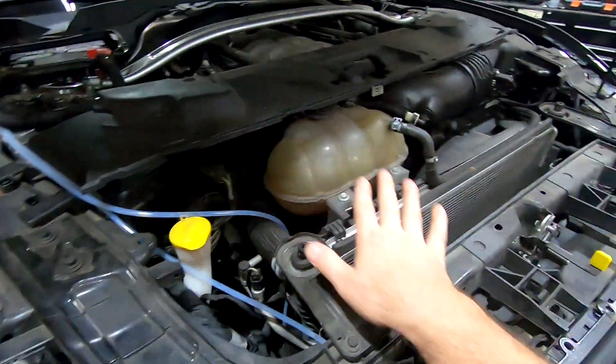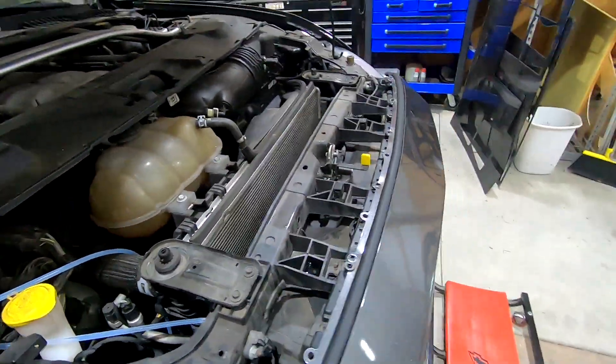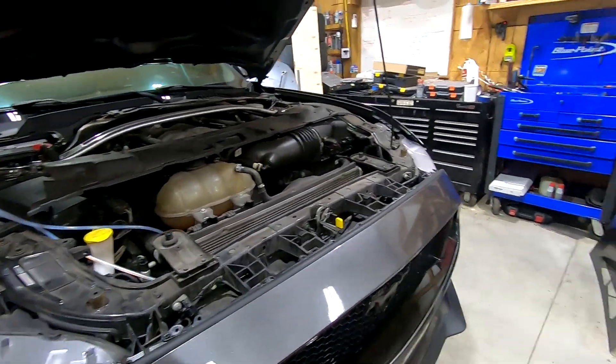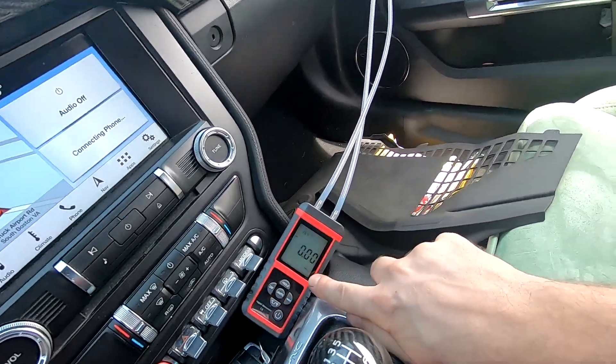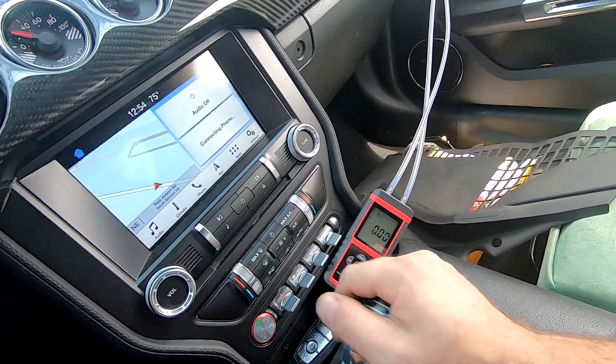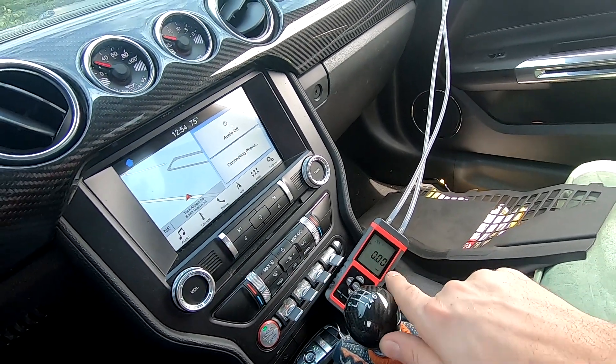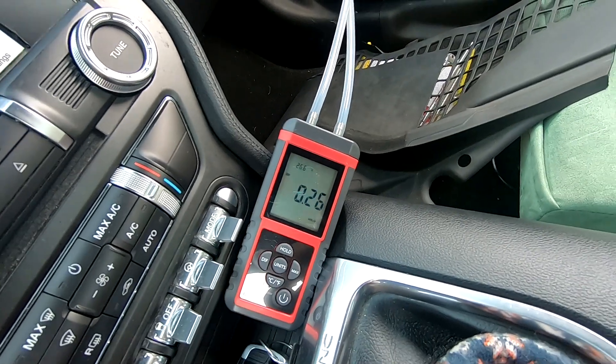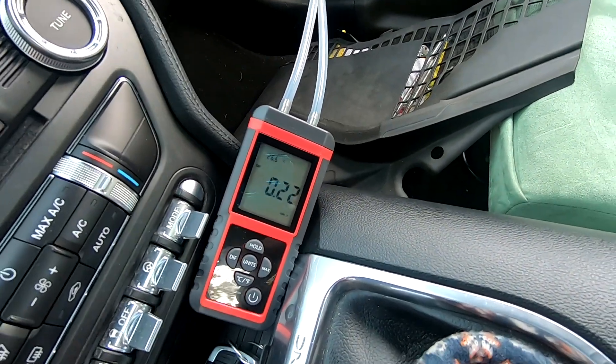The math is pretty simple — you have your initial front-of-radiator and back-of-radiator readings. Once we put our baffle on and seal up the lower side of the radiator, you'll have a different front pressure and back pressure, and you can do the math from there. We will be putting the upper back on because that does kind of seal up the top, but yeah, let's go do our initial runs. All right, we're ready to do our first pass — gauge is in inches of water, we're zeroed out, getting up to 60 miles an hour. We got 0.20 to 0.23.